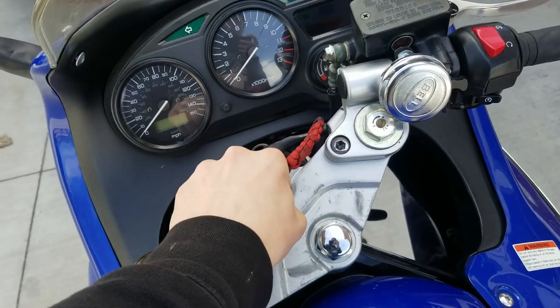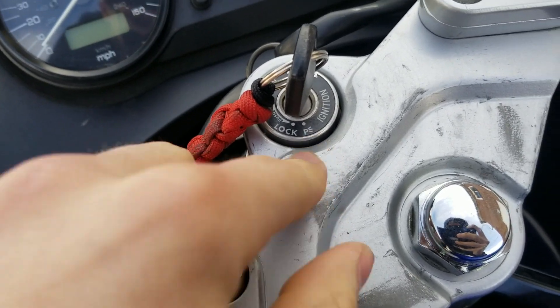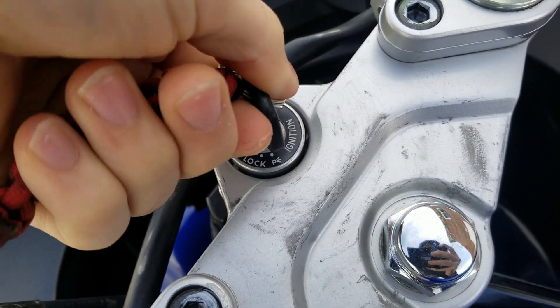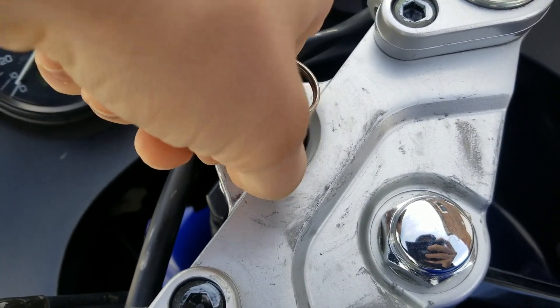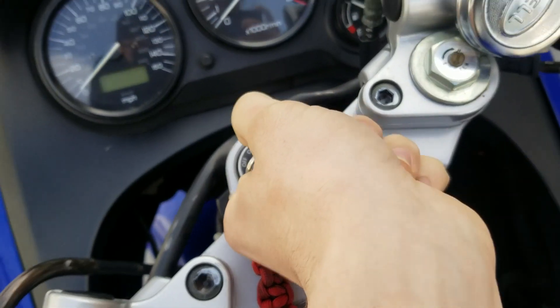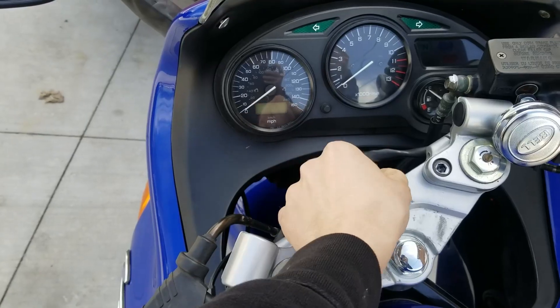Let's start it up. There's something you should know — I found out the hard way. There are parking lights on this bike when you lock the steering wheel. If you go all the way back you actually turn on the parking lights, which could kill your battery. Just click it back into lock mode instead of parking light mode so you don't kill your battery and get stuck somewhere.